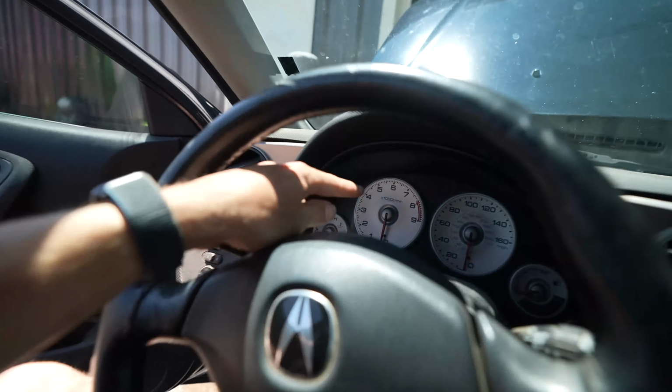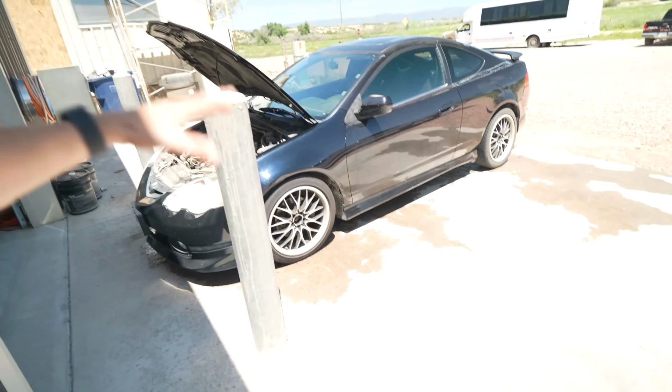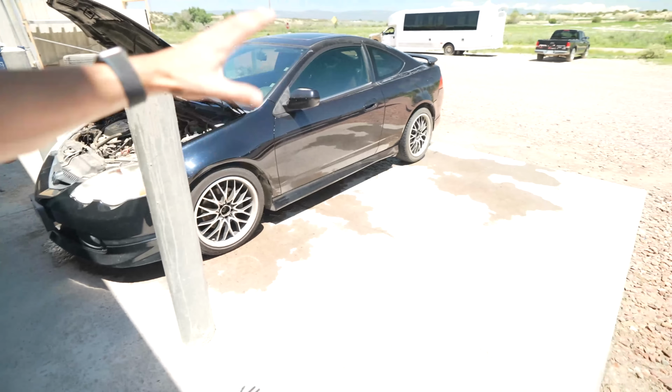One of the first steps in painting a car is completely degreasing it. You don't know if somebody did some wash and wax, some ceramic coat, some carnauba wax. Paint doesn't like to stick with that, and so the best thing you could do to start off your paint job on the right foot is to completely get rid of all the waxes, all the other crap, and then actually wash the panels really nice, so that way you could see what you're actually working with.